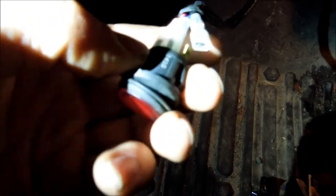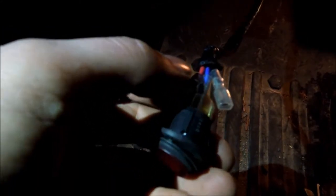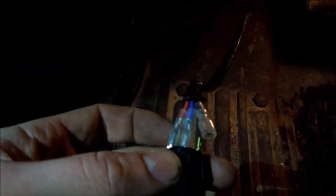So if you have a switch you've just picked up, or you're using the one from the kit, how do you know which wire goes where? The ground will go on the gold connector. Your blue wire — basically the trigger wire for the light — is going to go in the center. And then your red wire, which is your positive, will go on the opposite side of the gold. That's how you're going to wire up your switch.